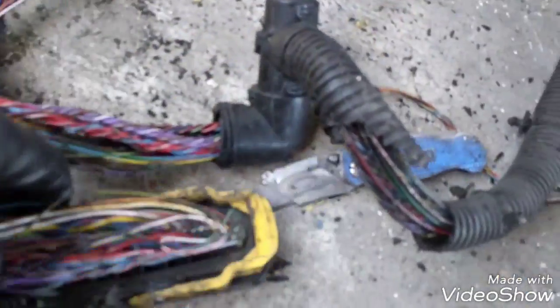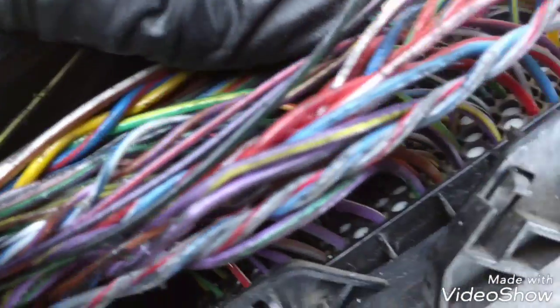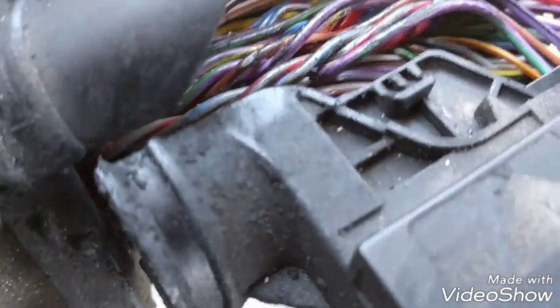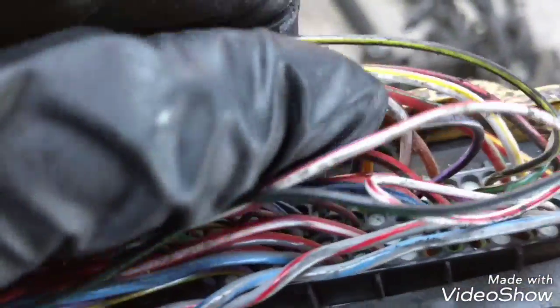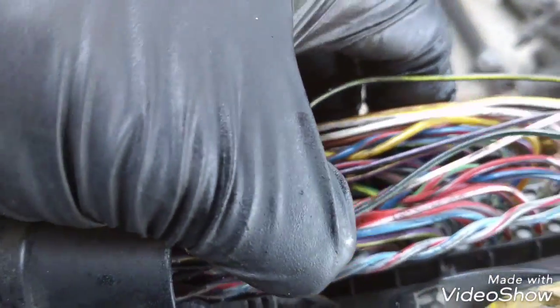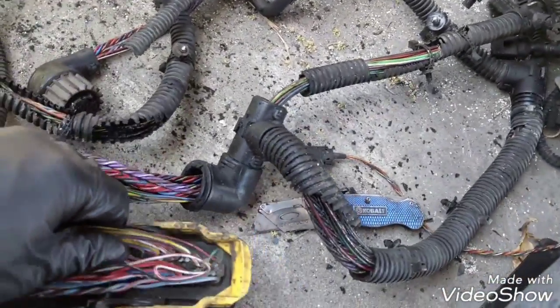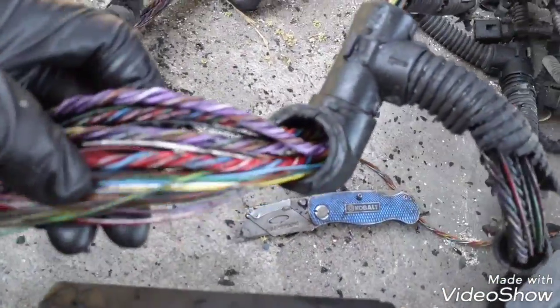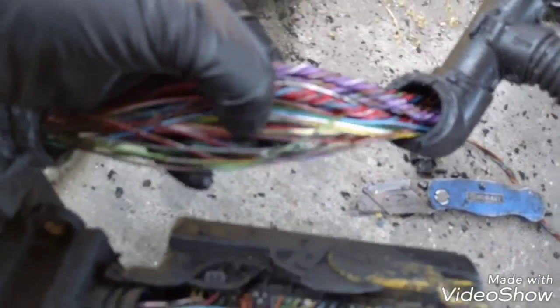As you can see, I'm going to show you again here all the areas of the harness — as you can see they're all damaged, they're all damaged because they are rubbing to each other, and this causes so many problems with the engine showing check engine light, or the red light as well sometimes. In many cases it shows the red light for no reason, and this is the cause of that problem.